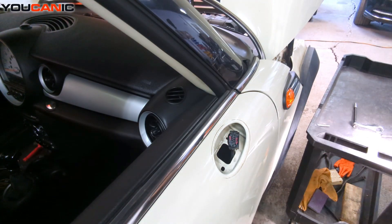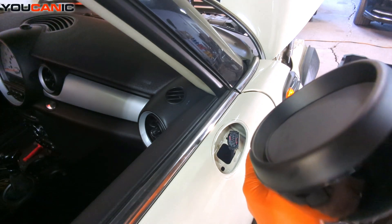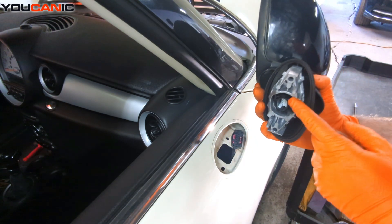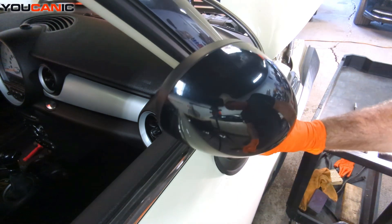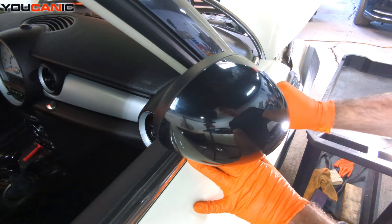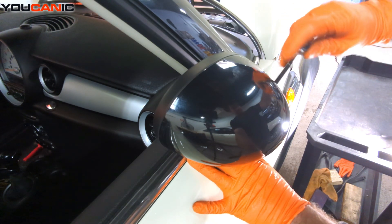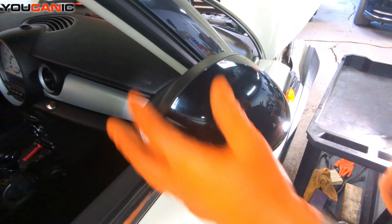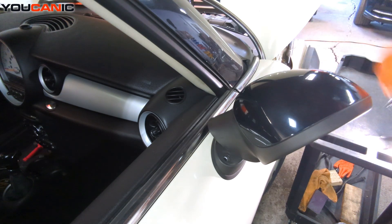Go ahead and get your new mirror. We just go in reverse order, lining the connection up — we've got the square tabs on this side — so get that connection hooked up and set it in there. They've got two little alignment tabs to line up in there, and then go ahead and put our five millimeter bolt on the front. Snug that up into place, then get this one lined up and tighten it, then come back and tighten the one up front.